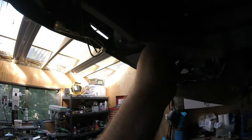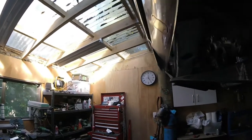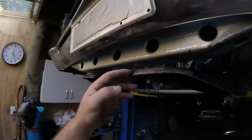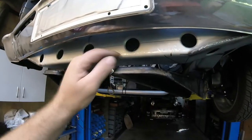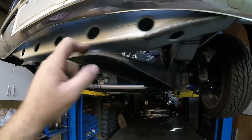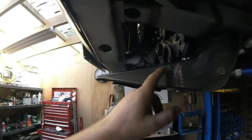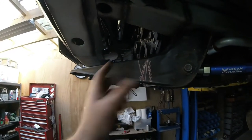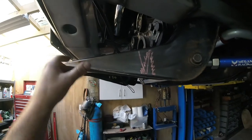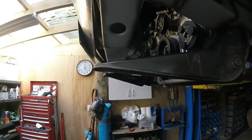Bit of work to do on the ends obviously - can't just leave it as it is there. I've still got to do a plate on here, a whole heap of tidying up. I'll put a doubler on the inside of here, put a couple of captive nuts. It's most likely all that's going to happen is take a section out of here - that will bend up, take a section out of there, that will straighten back down again, bolt it directly onto that. It'll be nice.